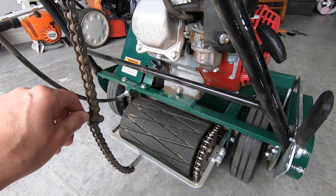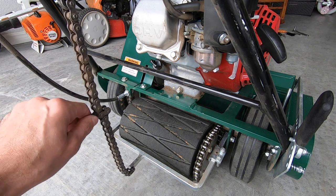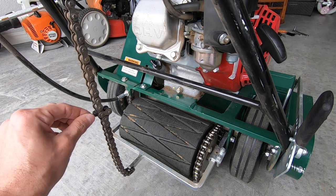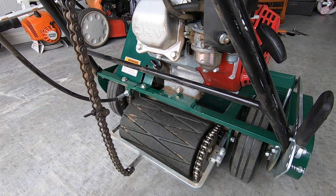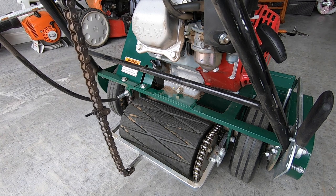You can see right here I've already got one in place — an adjustment I made after using the mower for some time. I've got a zip tie in there, just bringing the chain up one link, and so far that has been working just fine. But one time when I had it like this, that zip tie snapped on me, so I got to thinking there has to be another way.